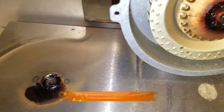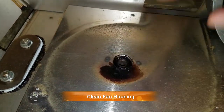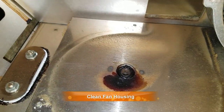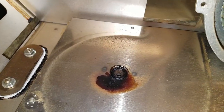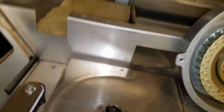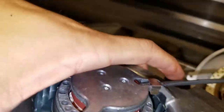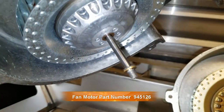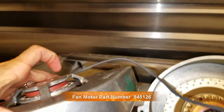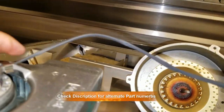Once you remove the old motor, take a minute and try to clean out this stuff here - just scrub it off. That way it will prevent any oil migration and grease from sticking to the fan, which can prevent it from turning and potentially burn out the coils in there. Once you clean it out, go ahead and install the new motor here - it will just slide right in. You may have to take these little clips off to get it in place, but then it will just slide into place. I'm going to clean that up real quick and then install the fans and show you how to wire them up.